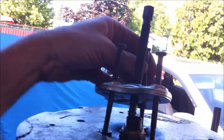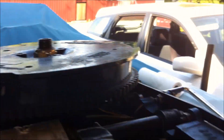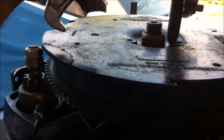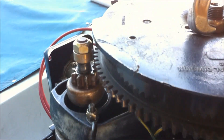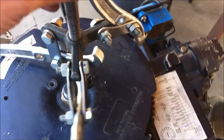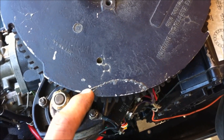Another thing I did wrong — I'll quickly pop this unit off to show you. Use one of these proper pullers; don't use the other thing I'm about to show you, because I made a mistake. A lot of you have one of these pulling tools and I basically attached them on each edge, all three of them. But as you can see, there's this crack here — as I cinched up on this separator tool, the tooth bent and snapped this part off.